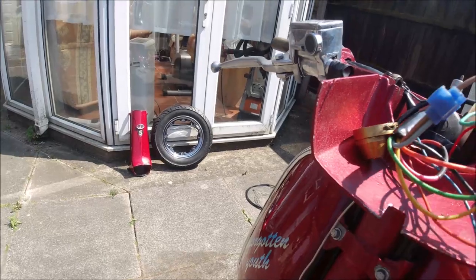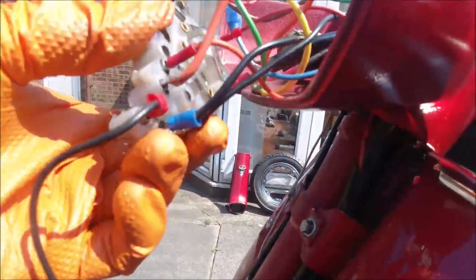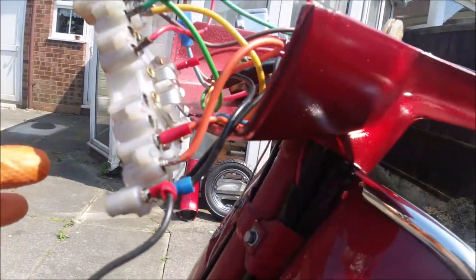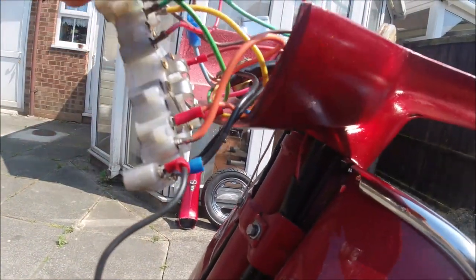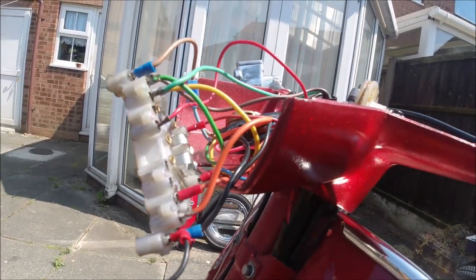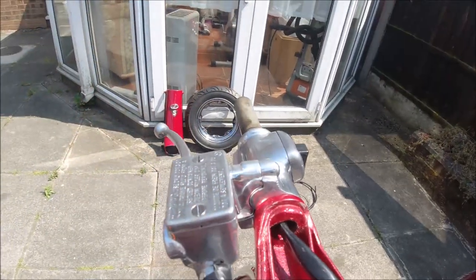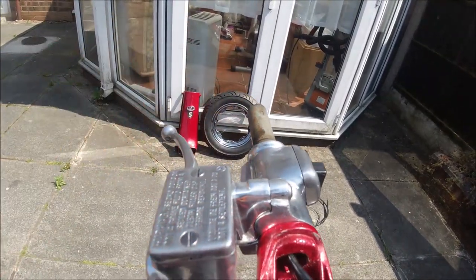You've got your earth on that side there going up. The black is backlight, pilot light, and obviously feeds into it. You've got an earth which with Lambrettas goes through the screws that hold on the top of the handlebar. All I've got to do now is put the rod back in again and put a dab of grease on there so that it runs smoothly. I've got to put the nylon in the end that came off with it.